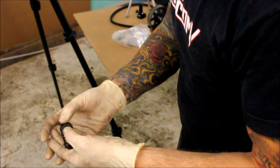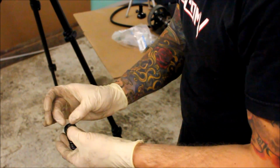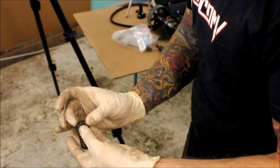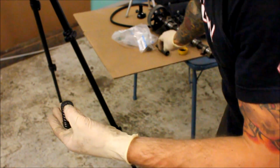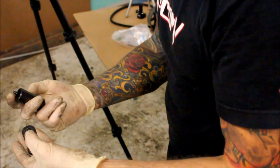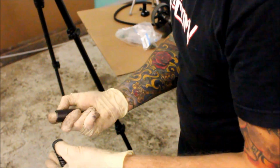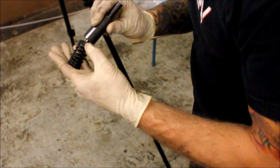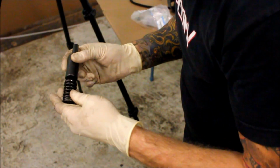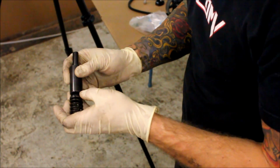So, with the valve stem here, as you compress the spring, these two halves are going to separate and come apart. When they do, the tool, which is spring loaded and has a beveled head right here, is going to put pressure and push these down. So this is going to be loaded and ready to go, and as you hammer this and this comes down, it's going to put constant pressure on the locks.